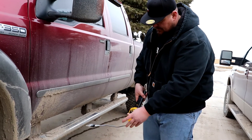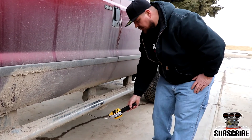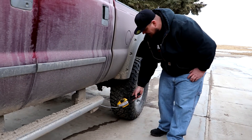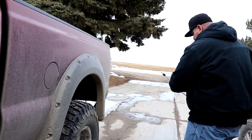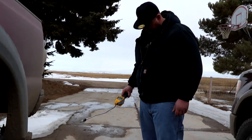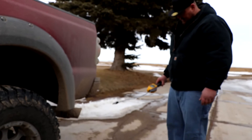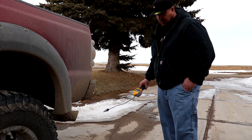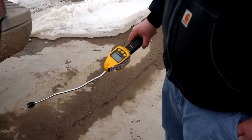Let's go along. None. None. Now this has a dual exhaust that exits out the side on the back, so I'll just keep going until it actually registers something. We're still at zero. Now we're right here — here's the exhaust. I don't want to get too close because I don't want to mess up the sensor, but we'll get close enough where it can actually pick some up. We've got two, four — the wind is kind of messing with it a little bit. So apparently this truck burns very, very efficiently because right now we only have six parts per million. Eight, nine, ten, eleven, twelve.